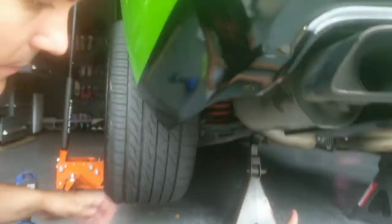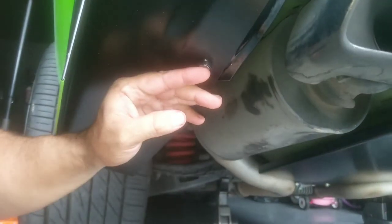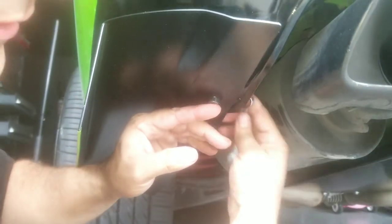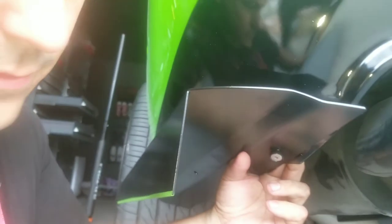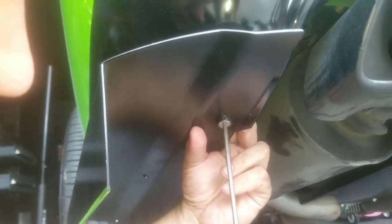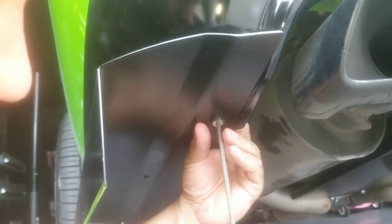As you can see, we took that clip and popped it out. All you're doing is throwing that bolt in there, reach your hand right up top — washer goes on, nylon washer, nylon bolt. Get your open-ended 7/16ths, put that on top, and then your 5/32nds. When they cut these they give you a little bit of wiggle room, so don't tighten it all the way down just yet. Get it so you can hold it on there and everything's not flopping around, so you can still shimmy it left and right to line up the holes that you drilled.